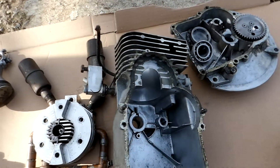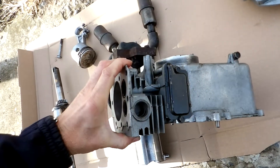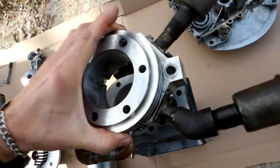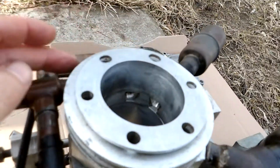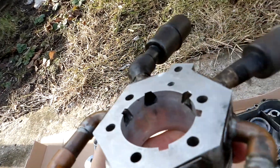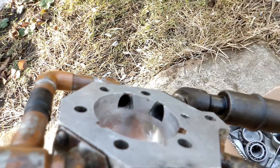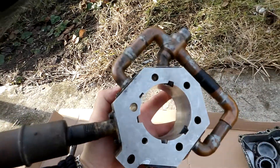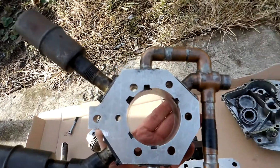This motor started life as a three and a half horse Briggs and Stratton flathead lawnmower engine. There's where the valves used to be — I've got the holes plugged just so that my oil in the crankcase doesn't leak out. We made this special port area that bolts onto the original block, providing three intake and two exhaust ports. There are two exhaust ports leading out, a compound intake port with two ports close together, and another intake port at the top. Not ideal port positioning, but I had to work around the head bolts.